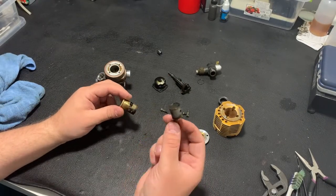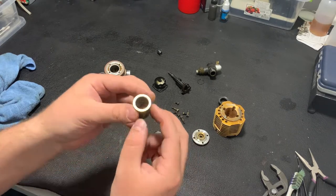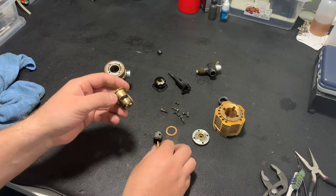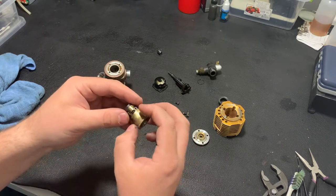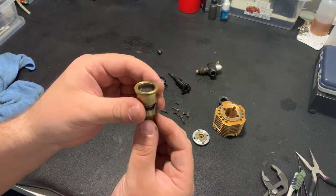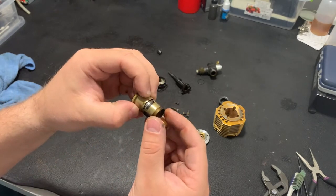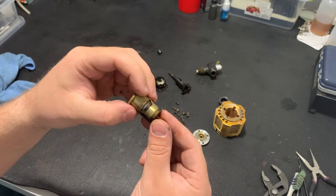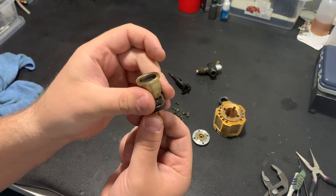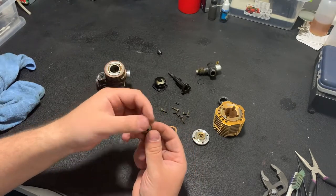What could I do with this? I know that this engine was never repaired. I could compress the sleeve just a little bit. For that, I will need to make a ring out of steel, put a piston inside at the top dead center of the engine, like here, and then compress the upper part of the sleeve to the point that the piston is not playing and not going too far up. It's what I want to try to do.